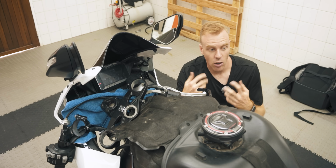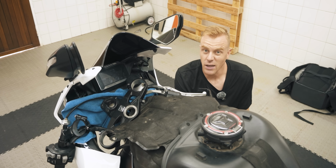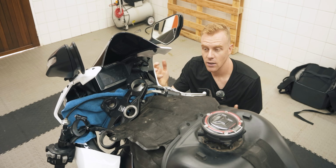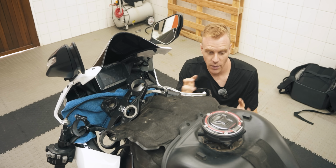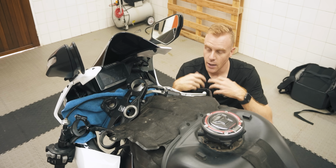It seems like a pretty convoluted process, but I did it so many times that I actually got pretty fast at it. And it works. When you turn the ignition on after that, the check engine light is gone. However, when I started the engine, a few seconds later, the light would return, which meant that it wasn't me clearing the oil out of the cylinders that caused the light, it was something else.